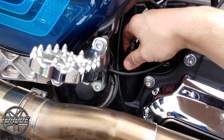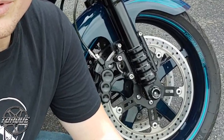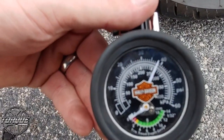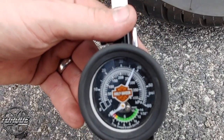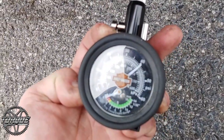At this point we're going to move on to tires and brakes. Because there's not a lot of air in these tires, it doesn't take a lot of air loss to drastically change the tire pressure, so it's always a good idea to check your tire pressures. We try to keep our tires around 40 psi. Front tire is just below 40 — probably 38 psi. Rear is right around 41.